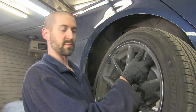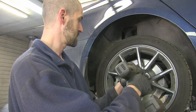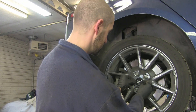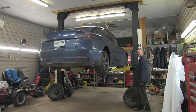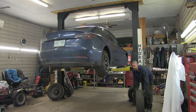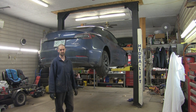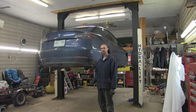And so we can rotate it, we're going to put the right front wheel on the right rear. Before we put these tires away, we're just going to mark the right front, right rear, left front, left rear, and we're going to make a measurement of the tires just to see where they're at. Marking the tires helps you next season when you go to put them on so you can rotate them properly. I'm going to continue the brake service on the other side but I just won't take the time to explain it since we've already seen it.